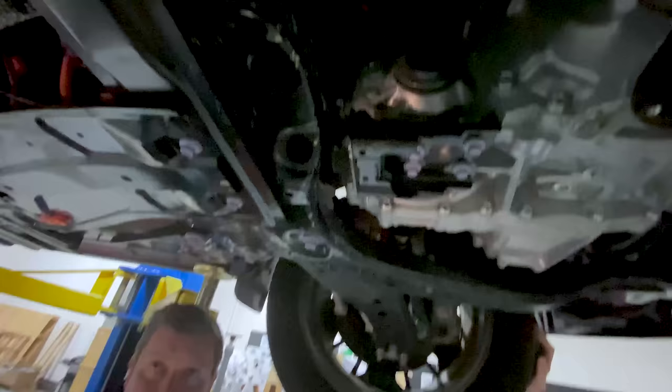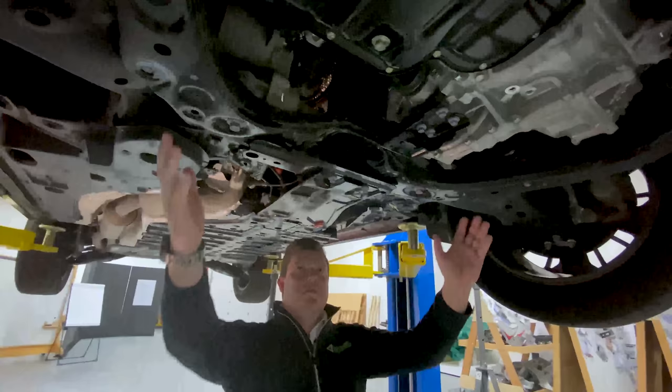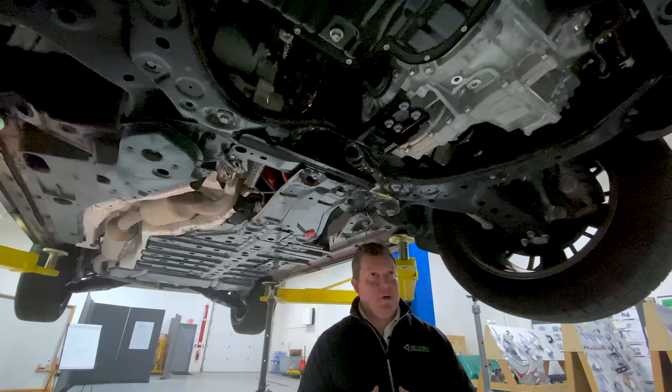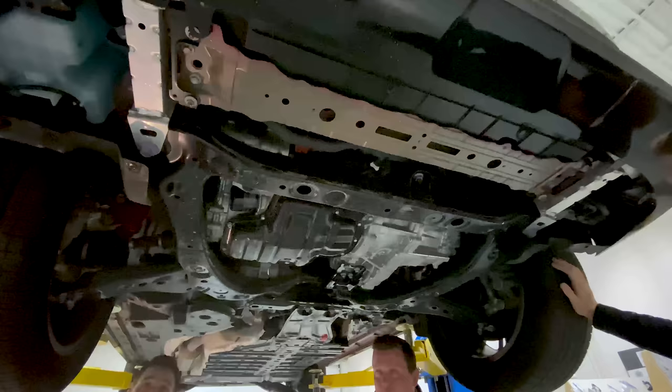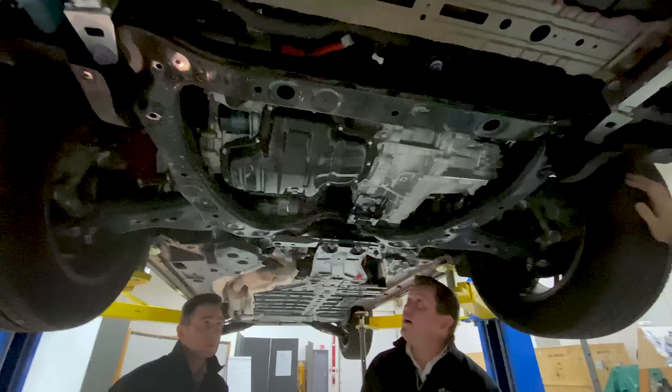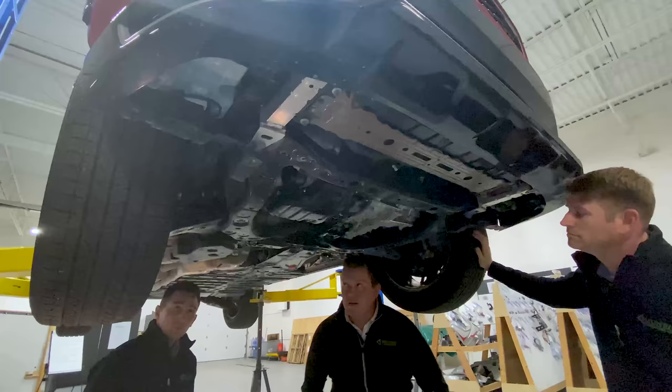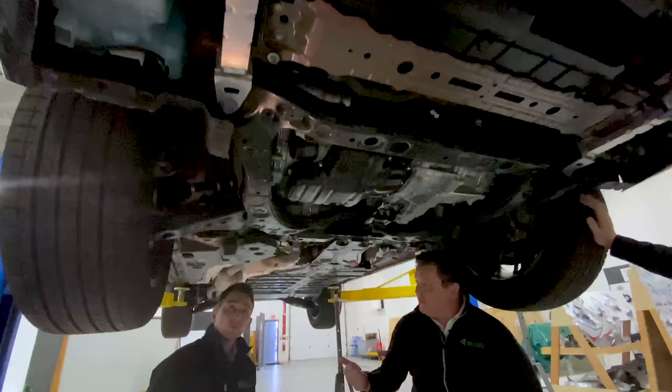When we looked at the Kia and Hyundai they had a simple K-frame, which is just the rear portion of the cradle. Toyota's previous D platform and now the new TNGA — and this is TNGA-K — have a full perimeter cradle that pulls the steel all the way up to the front. This is more typical of the 2010 to 2015 Toyota platforms, but they are hard mounting this cradle, whereas in the past they had isolated front cradles.